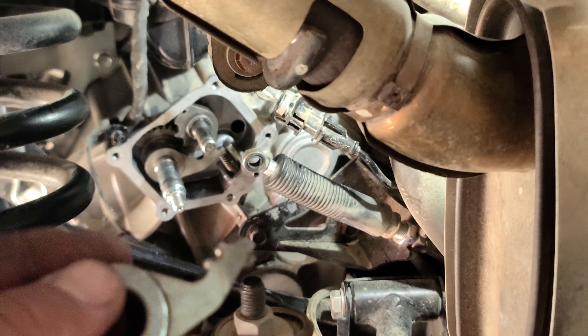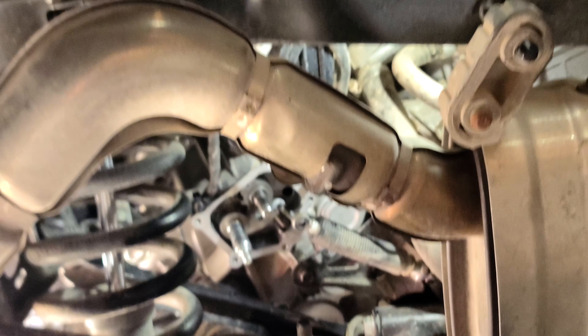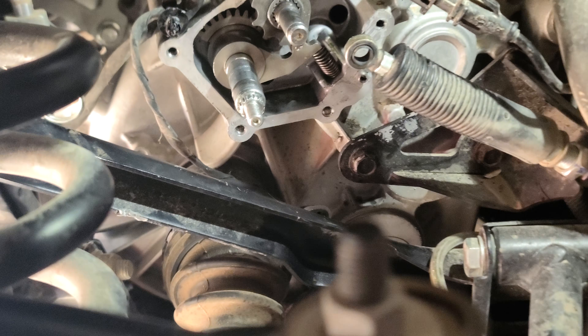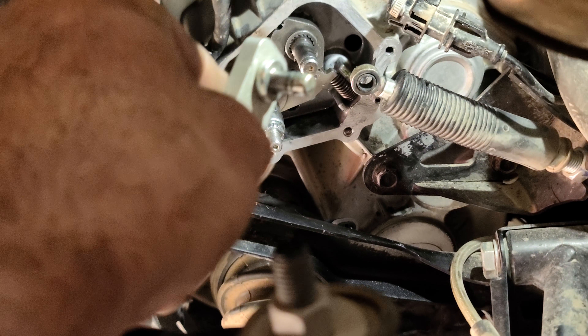What fails is the roller breaks off the detent and it'll be laying underneath this little cover. To access it, just lift your tailgate to get to the outer, and you'll have this linkage here — that's where your cable connects, right there on that shaft.